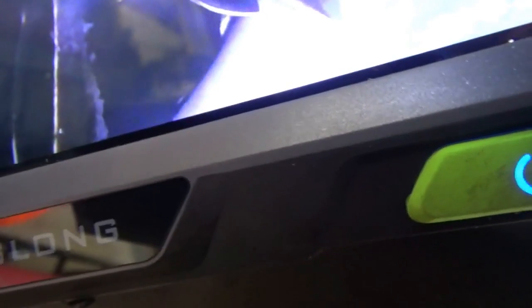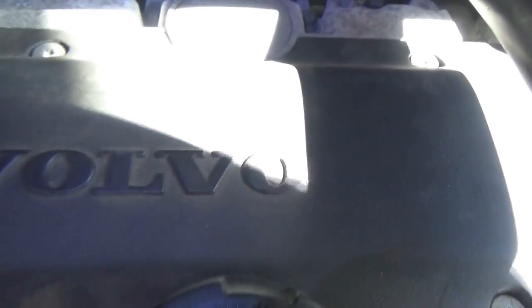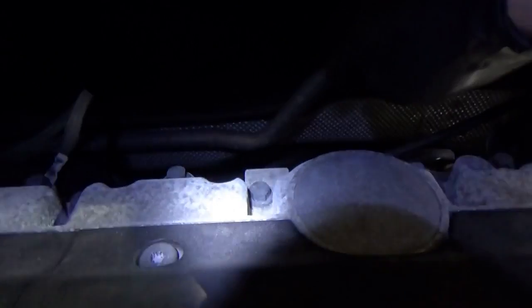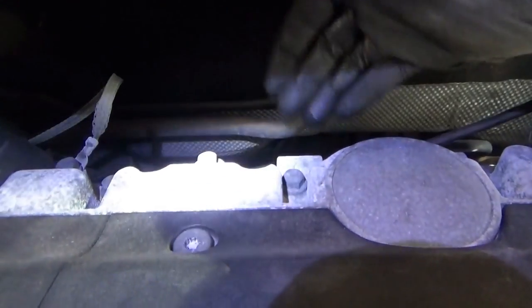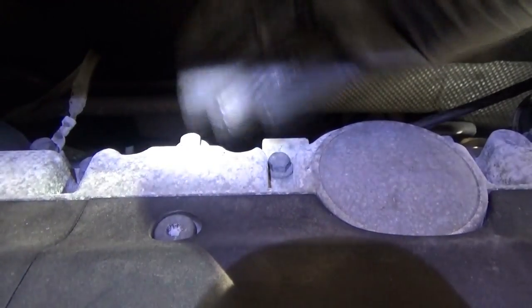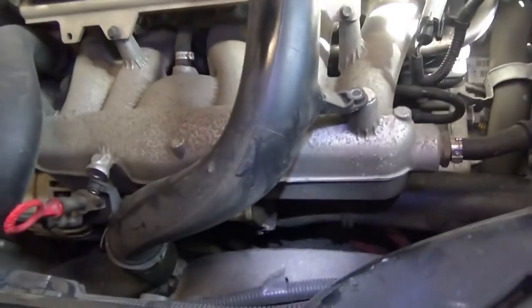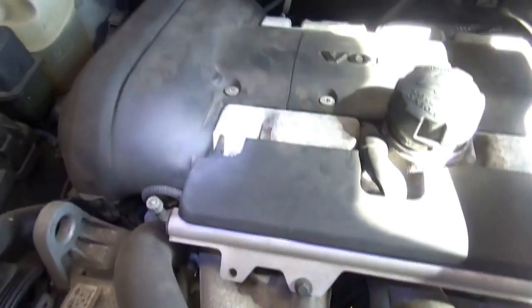So this is a mystery. We want to find the root cause of what actually got into the cylinder — where's the mechanical damage coming from? The last thing we could do is pop out the front oxygen sensor and look near the catalytic converter, because if debris got into the exhaust pipe, the cat mesh would stop it. But right now it's not clear at all what caused the mechanical damage on cylinder number one.